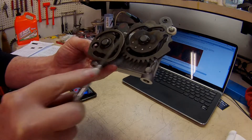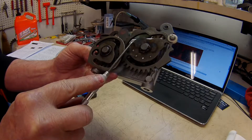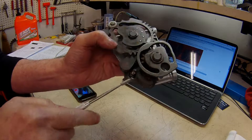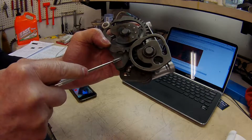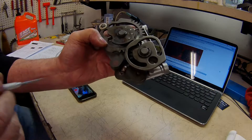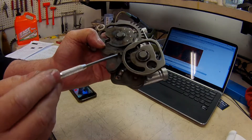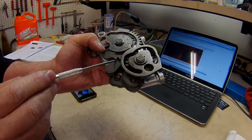So the 1977 change to prevent false neutrals requires a different neutral switch — it's a valley instead of a hill. That's separate from the shift kit, which consisted of: a cam change with steeper, more pointy lobes for better shifting; an offset segment; a different pawl; and a different spring. Those three shift kit changes were to prevent spring breakage, and apparently if the spring did break you would still be able to shift the bike based on the new pawl arm.